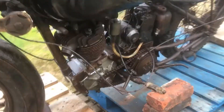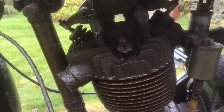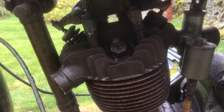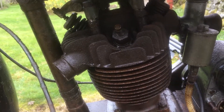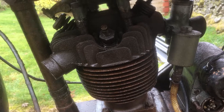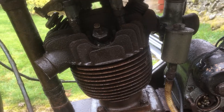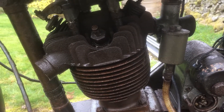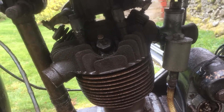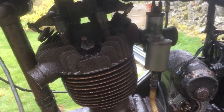After all that I turned the crank over, got back on to the crankshaft, turned it over until the piston was at bottom dead centre, and filled the oil right up to the top. I had a look before starting this video and it's still full up to the top, which is a good sign. The oil is not actually leaking past the rings - it may just be lubricating the rings slightly. If oil isn't leaking past the rings, that bodes well for compression and maybe I don't need new rings.